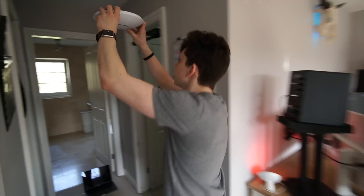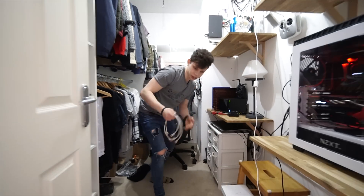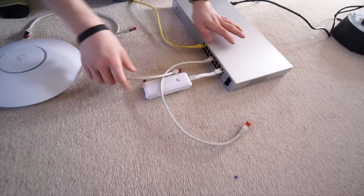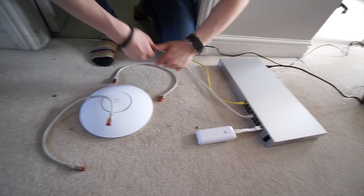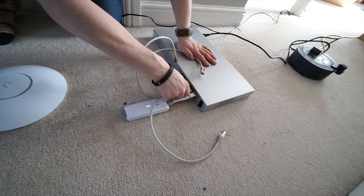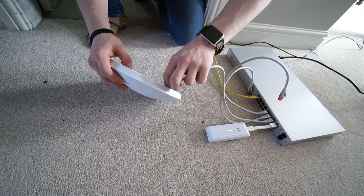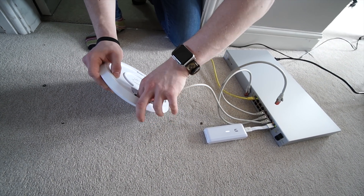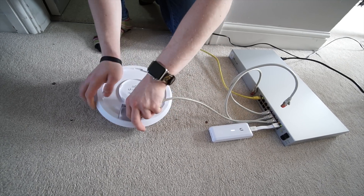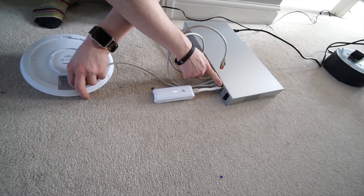This is going to replace my older access points. They're a fair bit bigger. While I'm testing all of this out down here, I'm just going to plug everything in — plug that one in there, that one in there, that one in there for my three access points — and the switch should detect that these devices need POE and supply them with power. As you can see, the Cloud Key is already powered on through the POE from the switch.